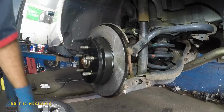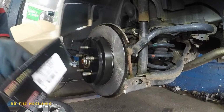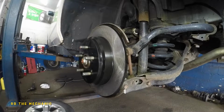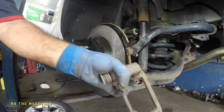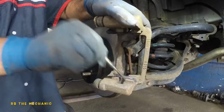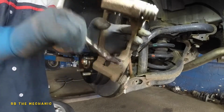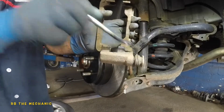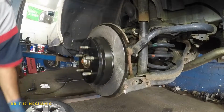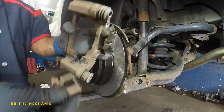So the next step here is inside your brake pad box. You're gonna have a hardware small little bag. It's gonna have these little guys. So what you do is you take your bracket. This is your bracket. Remember, we cleaned it. Now we need to put a little bit of grease right here, not a lot, because it's gonna squeeze out. And over here. That way, nothing is metal to metal. Okay, so they all look the same. The hardware, all 4 pieces look the same to me.